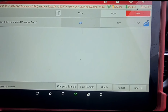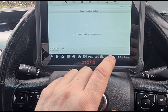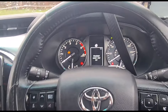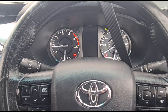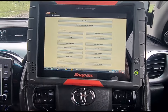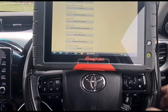We can see there the DPF is clean — we've only got about 2 to 4 millibars of pressure. We're not able to reset this light just yet, so I'm going to have to try a different diagnostic scan tool. We're going to try this one — same thing again. Cleared DPF values is complete. Let's see if that's worked. Nope, that's not done either. I tried the Snap-on here but it doesn't even list the DPF on here — nothing about resetting it or even checking it. There's no DPF data on this, so we'll have to exit that.